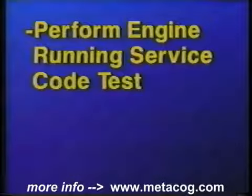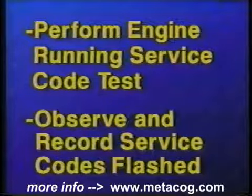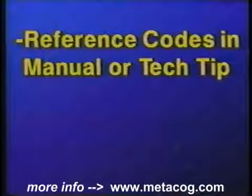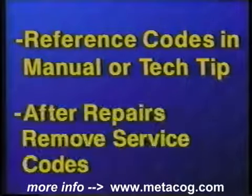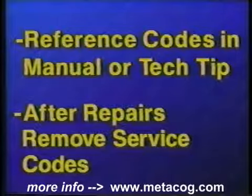Now, perform the engine running service code test. Watch for the dynamic engine response code, perform the required duties, and observe and record the service codes flashed. Once the codes have been given, reference the codes recorded in the service manual or tech tip. After the repairs are completed, clear the service codes by removing the code key during another engine running test.